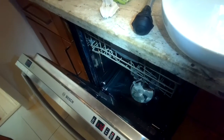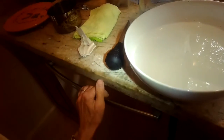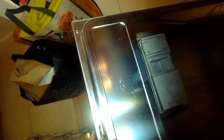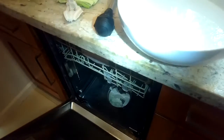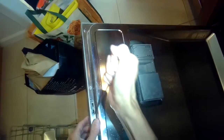What I notice on this dishwasher is that the motor worked sometimes and other times it seemed stuck — it was intermittent. If I gave the impeller a little push, it would start. That means either the impeller is partially stuck or the motor is just worn out. Bosch drain motors are great and last a long time; the customer mentioned this one is 10 years old. I'm pushing in on the door lock with a standard head screwdriver to make the dishwasher think the door is closed, then I'll set it to drain and watch what happens.